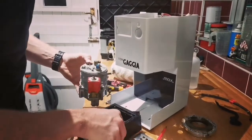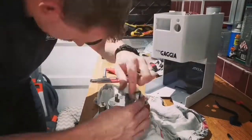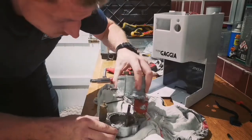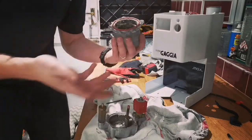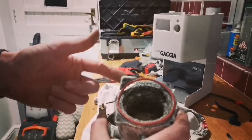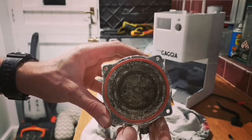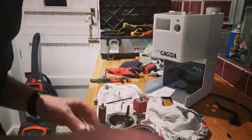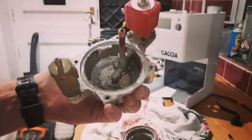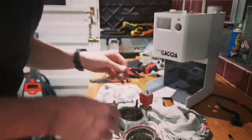It had been weeping for quite a while before it actually started to properly leak. The screws came out quite easily - they weren't too bad; a couple of them I had to tighten before releasing just to get a crack on there. As you can see, that is why it was leaking - the two side pieces, the little flanges that bolt it together, are broken. There's a lot of limescale inside; it was probably left with water in there, which has made the aluminium corrode. All in the bottom is just sediment - bits of corroded aluminium, bits of limescale - and all that got thrown in the descaler for a good clean.